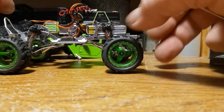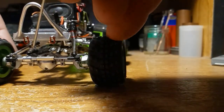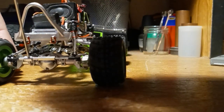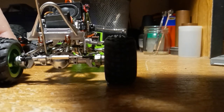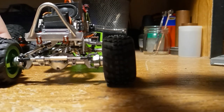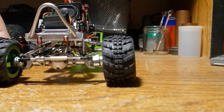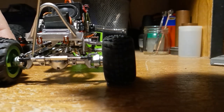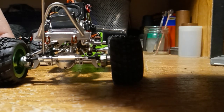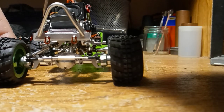I don't know the measurements of my links. This is from a rad line - about 13 or 14 years ago I had some rad line buggies, one dune buggy and two truggies stadium trucks. This was the adjustable suspension links. I turned this one down on my drill press so it would be small enough to fit in there, then threaded it.